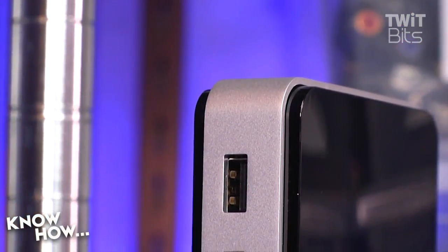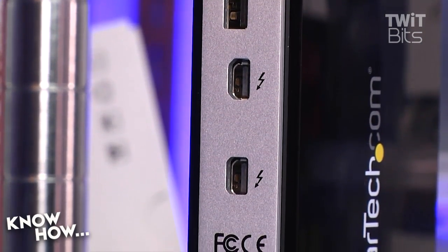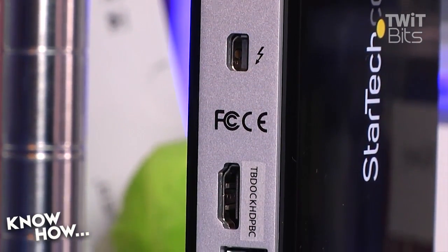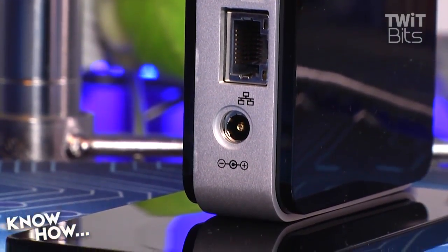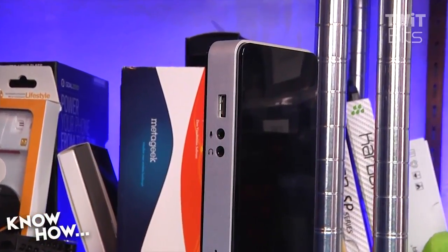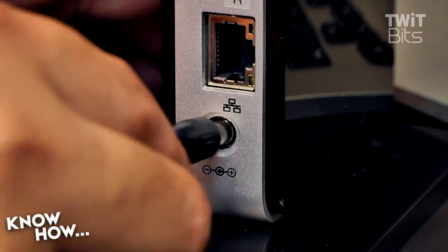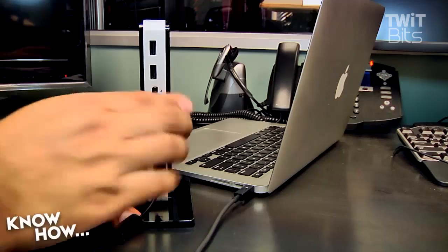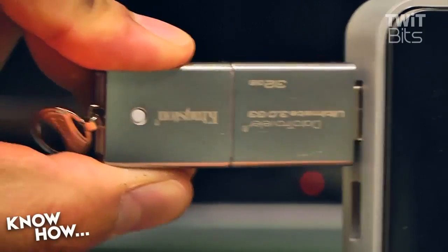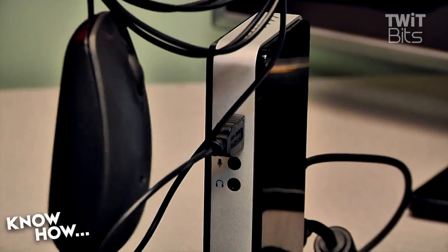With the ThunderDock, 1 port enters, many ports leave. The rear of the device is decked out with 2 USB 3.0 ports, 2 Thunderbolt ports with mini DisplayPort compatibility, an HDMI jack, and gigabit Ethernet. The front of the ThunderDock adds a 3rd USB 3.0 port and audio jack. Using the ThunderDock is simple. Powered up, connect one of the Thunderbolt ports to your properly equipped Mac or Windows PC, then connect USB, HDMI, Ethernet, audio, and additional Thunderbolt peripherals at will.